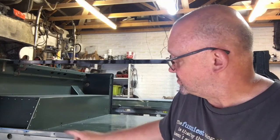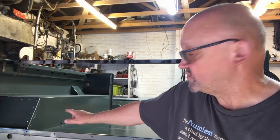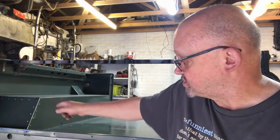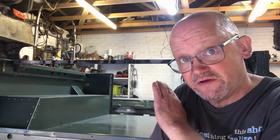And now what I've got to do is go around and sand all the edges nice and flush and get them all nice and even. So that's quite a chore. And it's now that you'll see why I've used the 1/8 pop rivets rather than going straight in with the 5mm pop rivets, because I'm using them almost as a guide to let the grinder touch them, and I'm not touching the parent metal then.